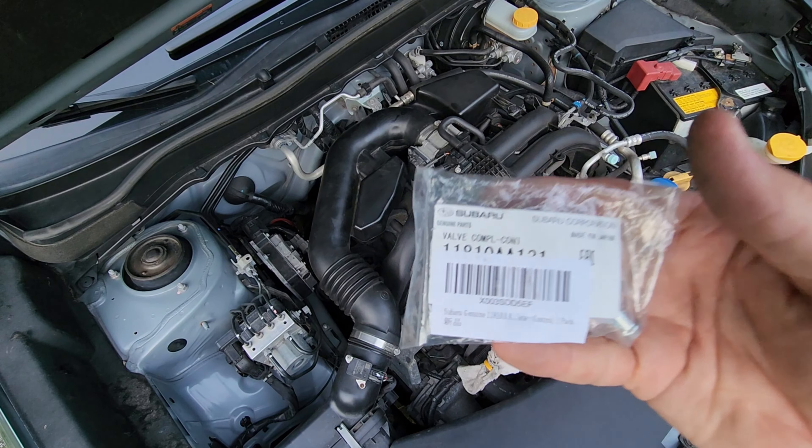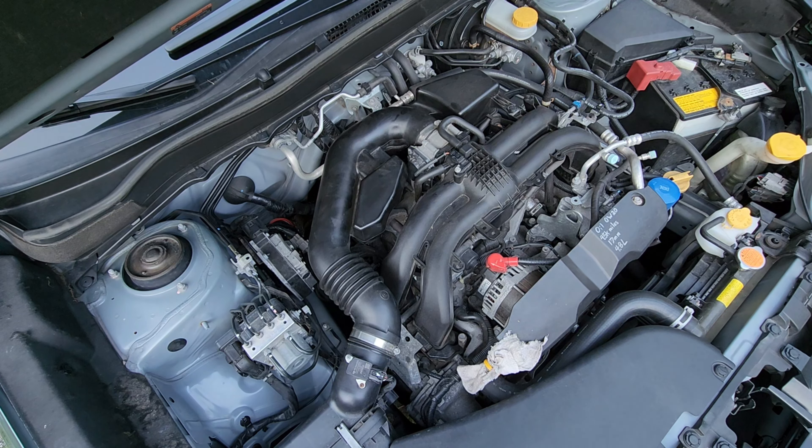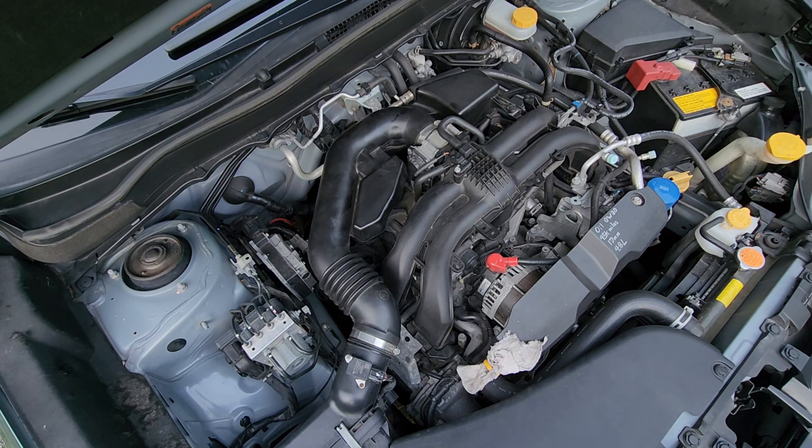It turns out we ordered the positive crankcase ventilation valve for no reason. I have 75,000 miles on the clock — it was a little gummy but it did not need to be replaced, so a little bit of an expense save there. Simple enough to get to; from my research online it seems like other cars are a little more difficult but this one is more straightforward. It can lead to oil consumption issues and blown seals. Simple enough to double check and easy enough to replace should you need to. The manufacturer recommends every 30,000 miles to go ahead and check it and/or replace it. This was just a quick walkthrough on how to get to that and how to replace it should you need to. Appreciate you guys stopping by — as always, this is Outside the Target Demographic, and I will catch you guys in the next video.